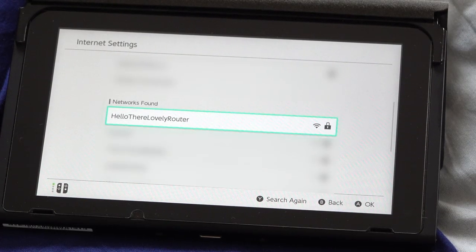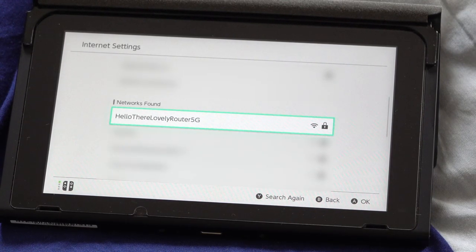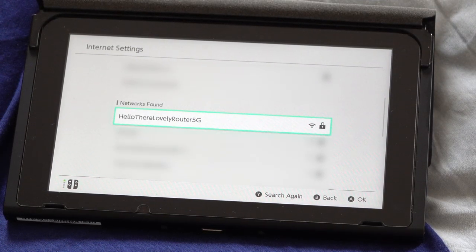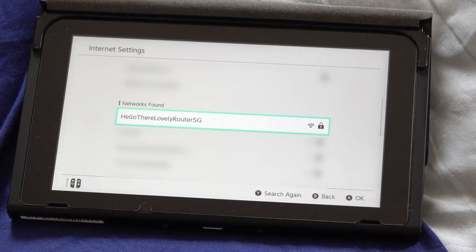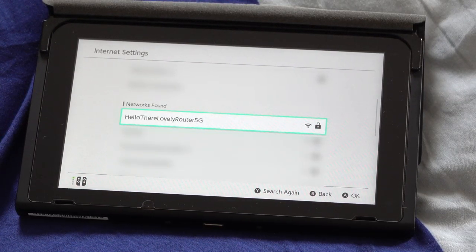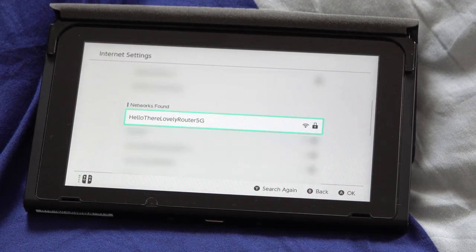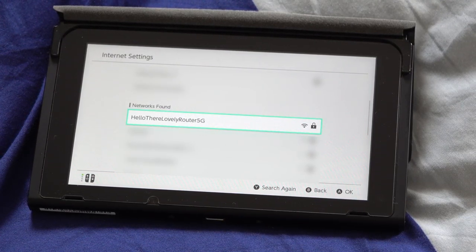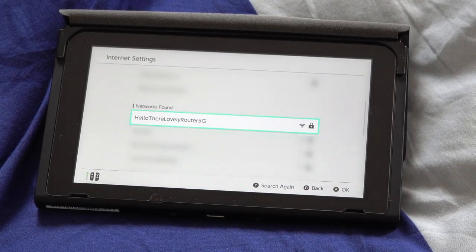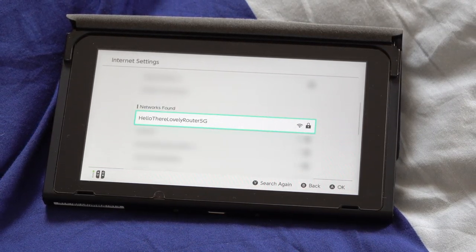To do this, you just need to connect to your router's 5GHz signal, which usually has the same name or SSID as your normal connection but with '5G' at the end by default. Some routers use exactly the same name for their 5GHz signal as their 2.4GHz signal — you can probably change that in your router settings. You may find trouble getting as strong a signal if your home has thick walls, but if you can get a good signal, 5GHz is always the better option.